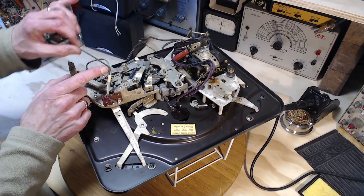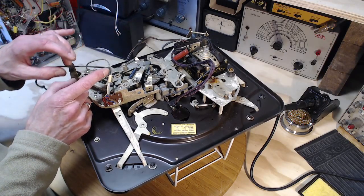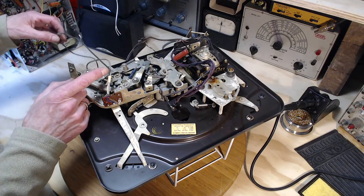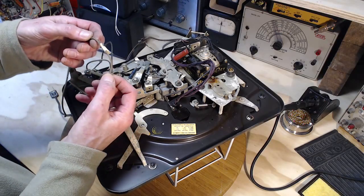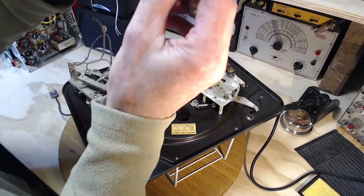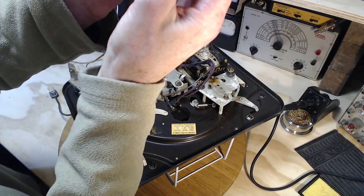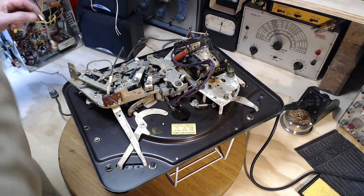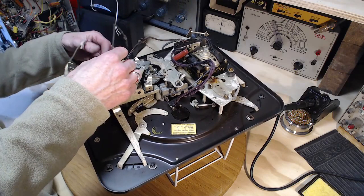And here, you can tell the insulation is broken because look, it's just swinging like there's a joint in there. Chance of a short circuit in there is really, really good. This wire is stiff enough that, listen to it. I'll put it up by the microphone here. I'm pretty sure you heard those clicks. That's me just bending this thing. So we'll have to change out the shielded wire.